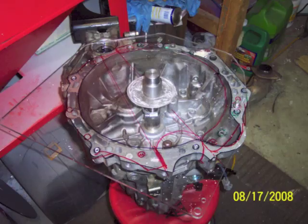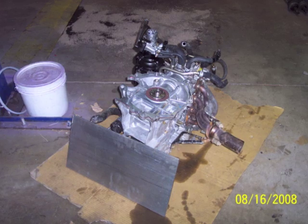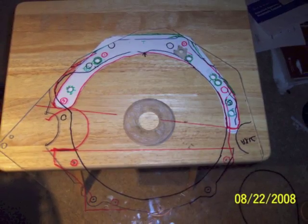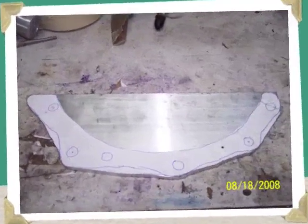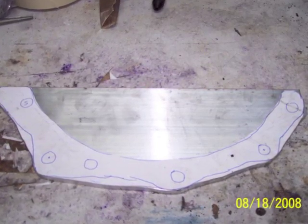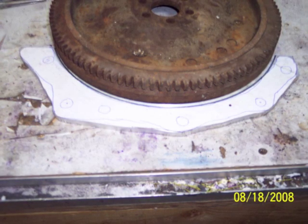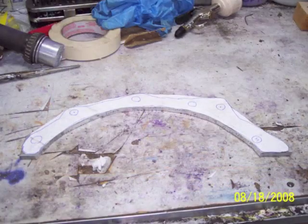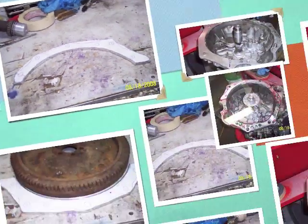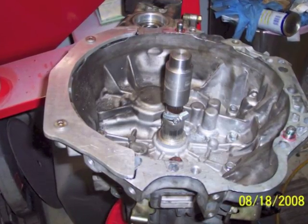Then I located carefully each hole. I picked up a piece of 6061 T6 aluminum at the scrap yard, and I made a paper template from the plexiglass template using double-sided masking tape and stuck that to the 6061. I cut it out on a bandsaw — a wood bandsaw with a non-ferrous metal cutting blade, so you can actually cut aluminum on a wood saw with the right blade.